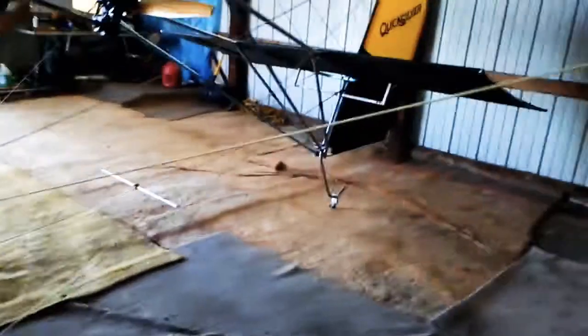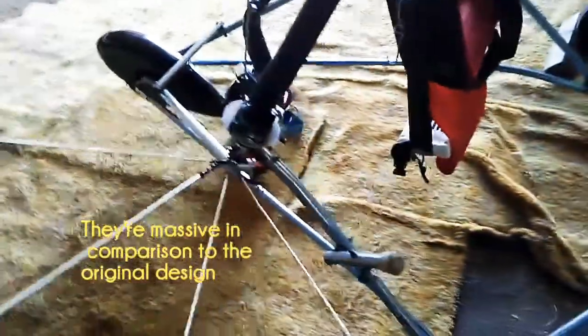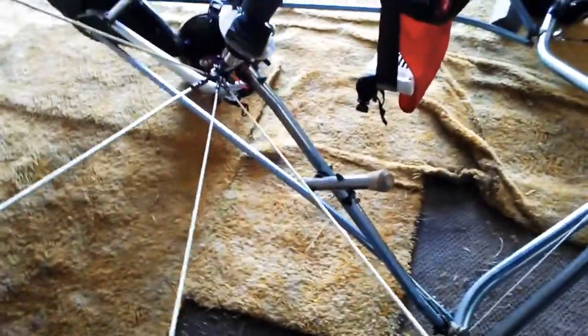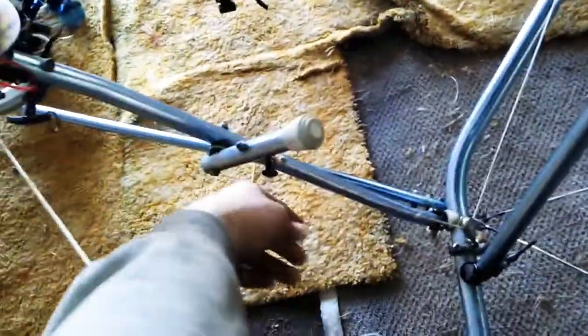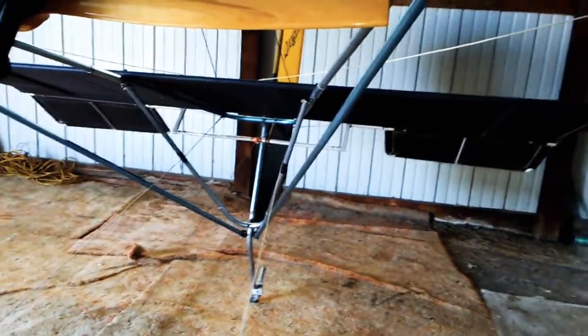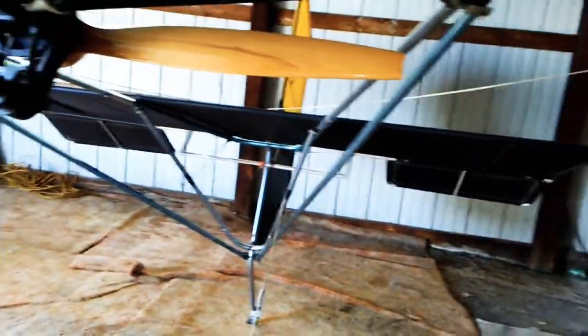This is my elevator trim lever. One of the modifications done to my airplane is the elevator trim. Up and down is controlled more like a paramotor — your throttle is going to bring you up, and you maintain a more or less level attitude. But if I want to get a little bit faster, much like a speed bar, I can push this lever and it runs a series of cables down to a homemade piece of equipment in the back. That will raise my tail and lower my nose, allowing me to get a little more speed without climbing in altitude — and it's useful for landing.